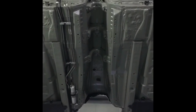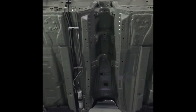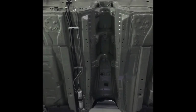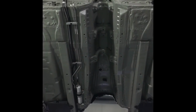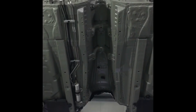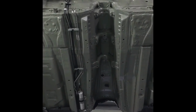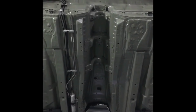So the rebuild process on the CSL has commenced. We've got the fuel lines on, the stainless steel BMW fuel lines that have been cleaned, along with the fuel filter and brackets and everything. Obviously, every single fixing that we can possibly order from BMW is going to be replaced during this process. Whether it be a simple speed clip or a self-tapping screw, or an axle bolt, a nut, a bracket, a chassis clip, or plastic nut, the lot. It just gets ordered, fitted, no expense spared. This is, to date, the ultimate underside restoration that we have carried out, and probably will carry out, to be honest.